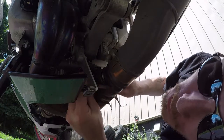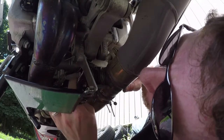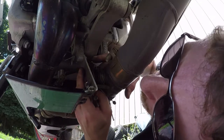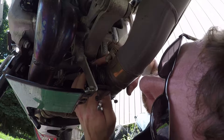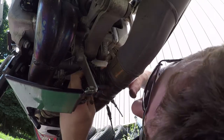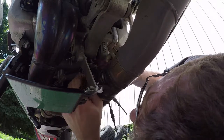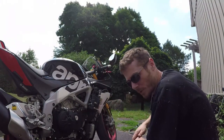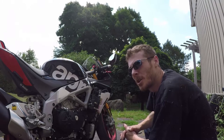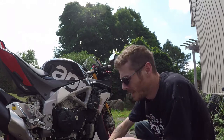It's pretty simple — literally the exact same process. There are just two poles, like a bracket keeping the cables in place. Loosen them and the cable comes right out. I'm removing the cable so you don't have a lot of rattling. I threw up a screenshot of exactly what the Aprilia service manual says about the butterfly valve. Just remember: do not unplug the servo — just remove the cables. That's all you need to do.